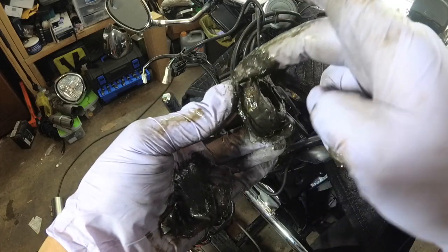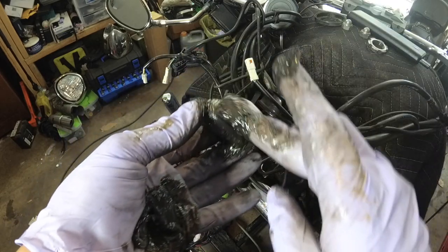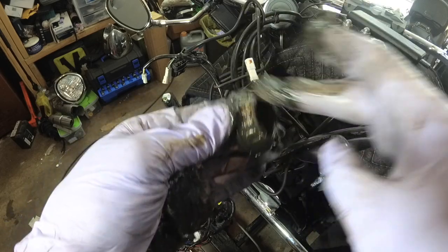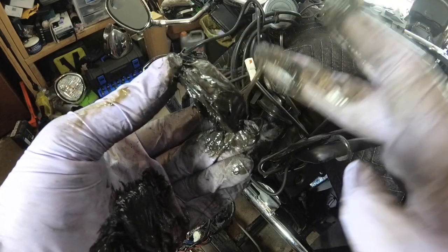Making sure this packs in there. After this I'll put this back in there and I will follow the manufacturer's directions for tightening this. When it's time for me to do a rear tire I'm going to do that rear swing arm again — I'm going to repack that with grease. That needs to be repacked, and that ought to be soon. I'll be doing that before the West Virginia trip.